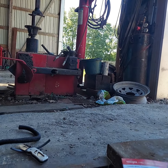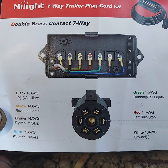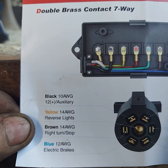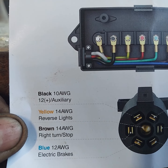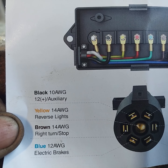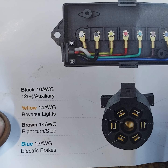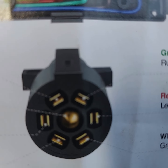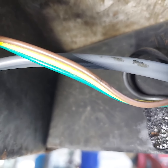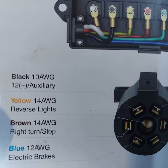Take a screenshot or stop the video. Up here top left: black is your auxiliary 12-volt power and yellow would be your backup light. Brown is your right turn and stop light signal on the seven-wire connector pigtail, but brown on your trailer harness connector — that's brown, yellow, and green — that is your marker light and tail light.